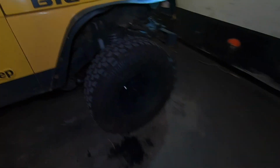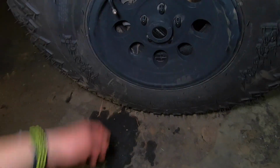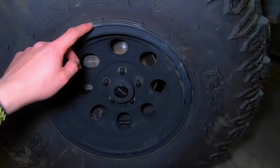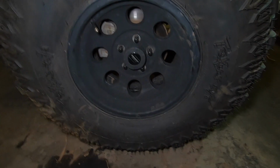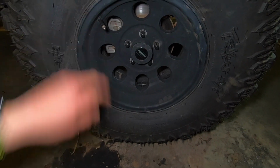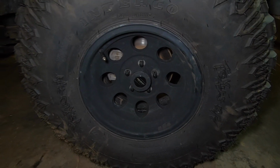I had pretty much every single tire leaking. I had this valve leaking. I think you guys remember that one. So we got a new valve. We got all of the tires taken off the beads and resealed, because if you remember, we kind of lost the bead a few times, and basically there was a lot of dirt inside the tire, and that's not good for anybody, not good for your balance, not good for anything, but it was basically leaking around the bead. A few of them more than the others, but we needed to address it, and we got it all done.